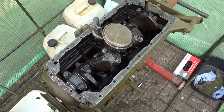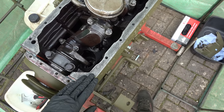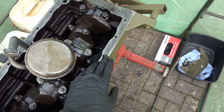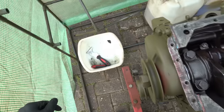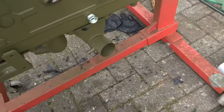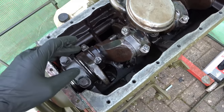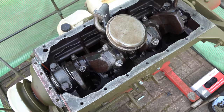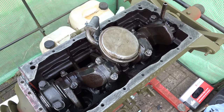I think I'm still vaguely alive in here - it's pretty bad, but as you can see we've got all that gasket off. That actually went better than expected. Look, you can see all the machining underneath and how it looked before. Got all that gasket off using a bit of acetone and the scraper. You can see why you don't want that stuff going in your engine - some of that fiber gets inside oil galleries, and if it gets into a big end gallery it's going to block it up and you're going to have oil problems. Your engine's going to get trashed.